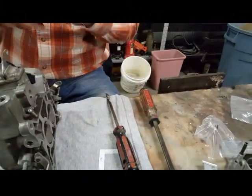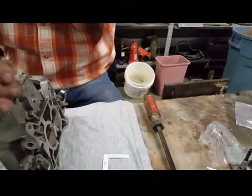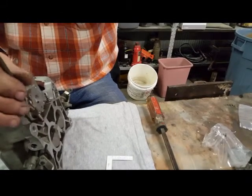And if you want them nice and clean, you don't want a ridge on them. If they've got a ridge on them, they've been screwed in way too tight. Where would the ridge be? Right out about a 1/16 of an inch from the tip. And then you'll never get a proper metering.